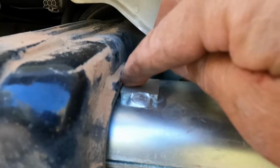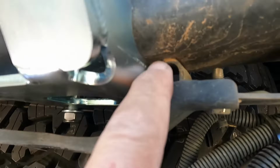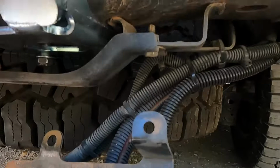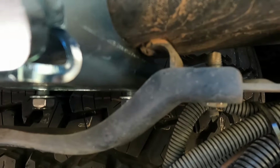And the bolts in underneath, and as you can see, the little tab here is home onto the chassis of the car. I've got the catch bracket on, but what I've found is that, see in the bottom there, the little bracket of the car is touching the catch bracket, and I can't achieve that 425 measurement. It's probably around 430, so maybe this needs a little grind or something like that. I'm going to get it all the way up to that little weld there, nip it up and do some other measuring and just see.